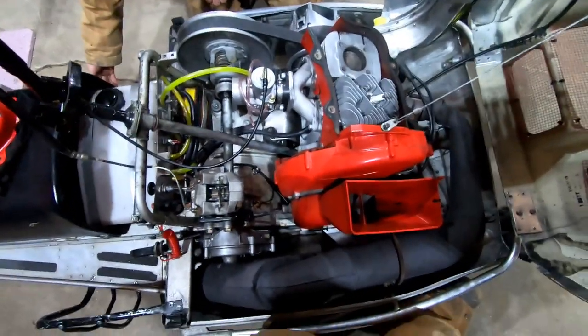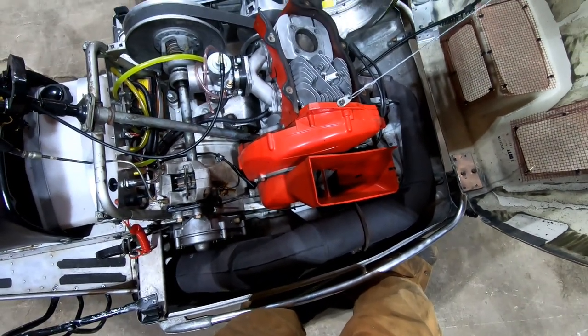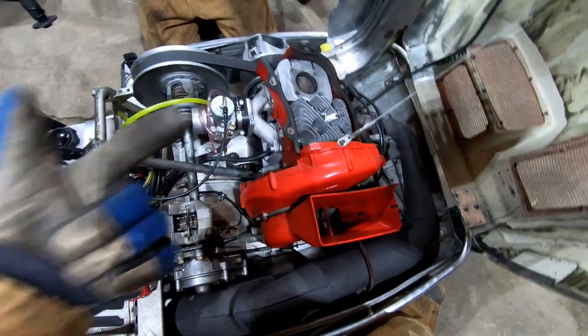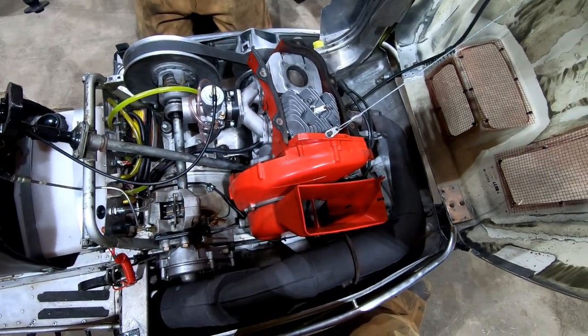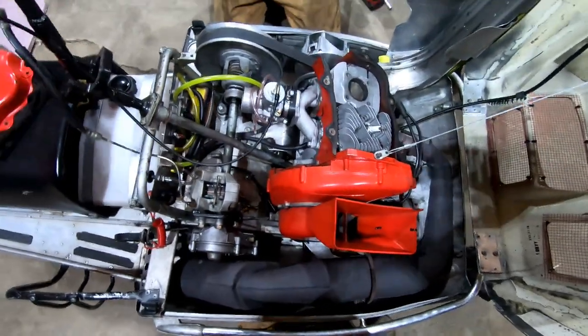It ain't much though. Oh, it probably just went out the exhaust because it's on top. The first thing that opens is the exhaust port. So if you're lucky, it'll go out the exhaust. And if it had really got in there, your cylinder would be way more messed up than that. It just got a little piece. It might have caught that and then it came out. So why is this so wet?